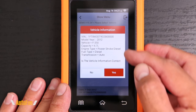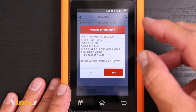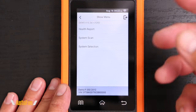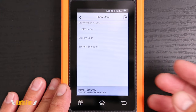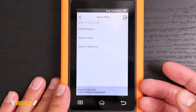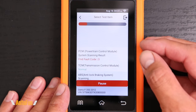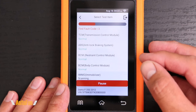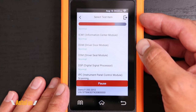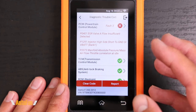As we can see right now, this is showing us the information of the vehicle. What you're seeing is the Launch Demo module, which is a great feature of these scanners. I really like it because it can be used to practice how to use this tool so we don't practice on a live car, or we can use it to train a potential technician. When we connect to the car, we're going to get three choices — one of them is to run a full health report, which checks every single module located in the vehicle. Newer cars are going to have more modules than older cars.